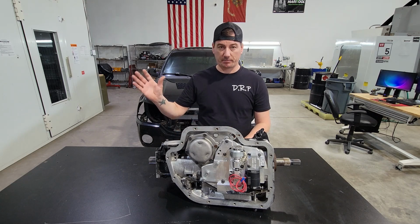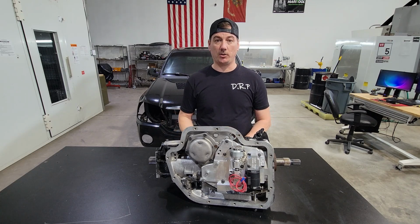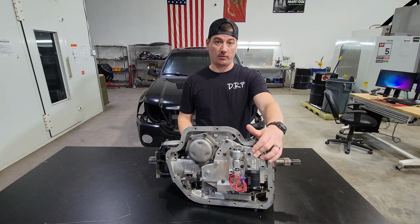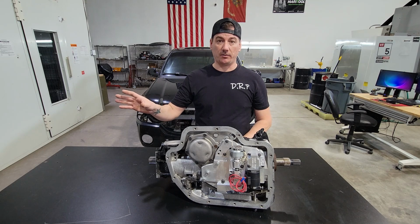When you see some of these higher horsepower transmissions, 2,000 horsepower up, 3,500 horsepower, they're using their external dump valves in a completely different way. They're using it after they leave the line, after they launch. What they're using to help get up on boost is what I have here, my spool assist valve. Okay, with my DIY kit and other aftermarket manufacturers.